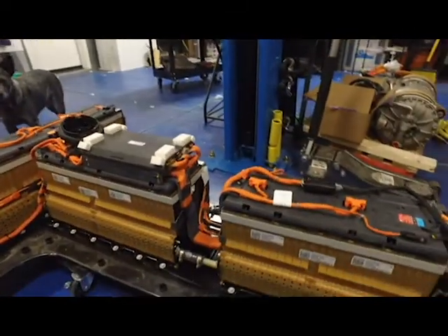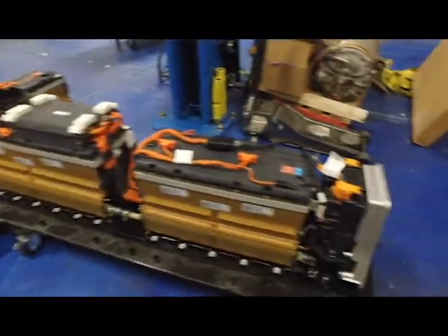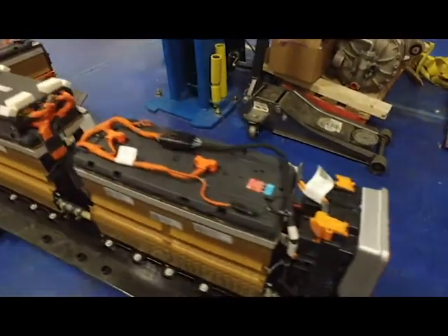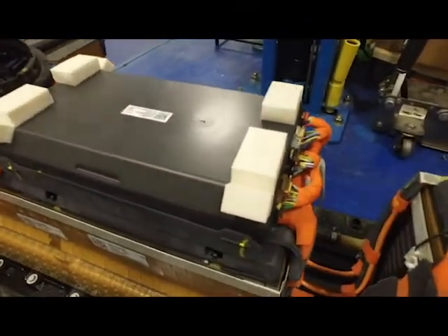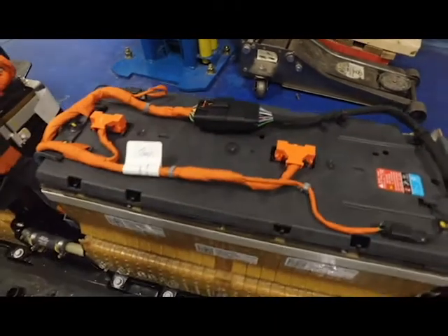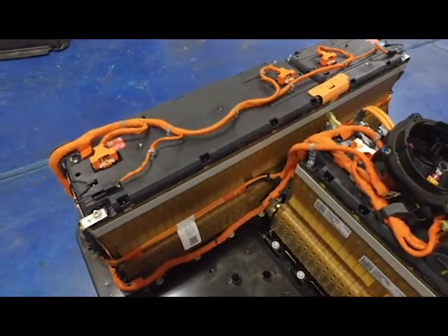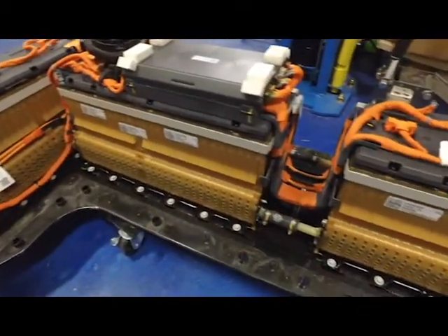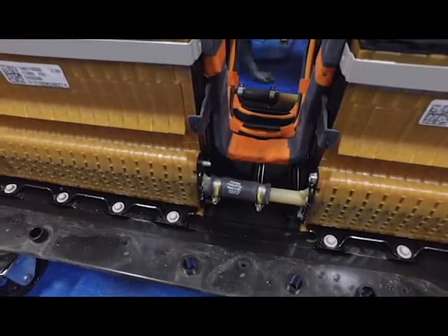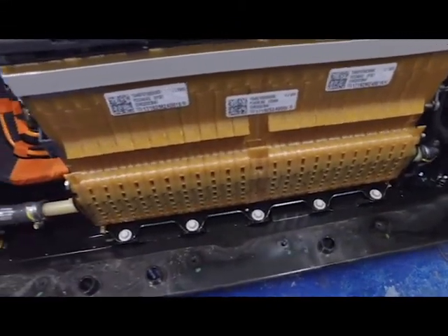Here's the battery pack without its cover on. Basically all of your factory plugs and everything are going to be up here. Got some water inlets down at the bottom. The battery management system box is here — all these small wires transfer to these plugs, and each individual wire goes to each individual cell so it can manage individual charge level per cell. We also have coolant lines that attach between each set, and coolant runs along the edges inside the battery modules on both sides.